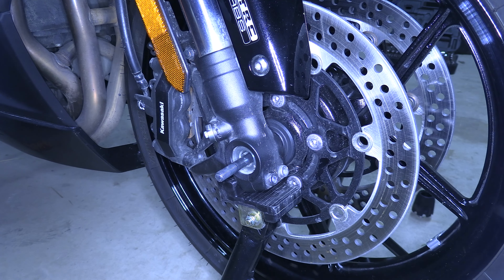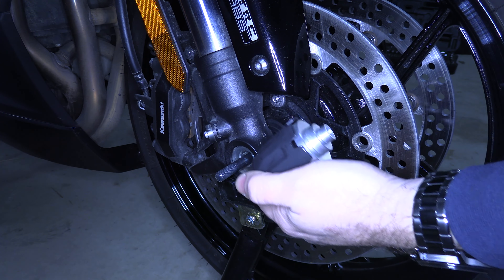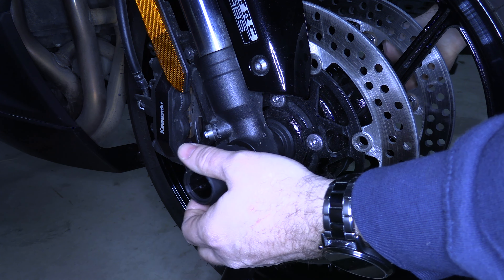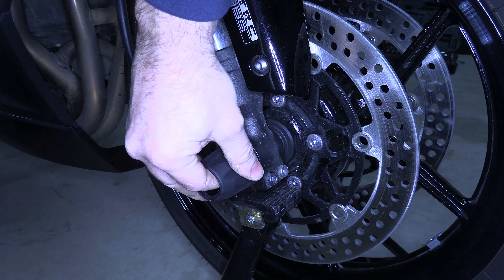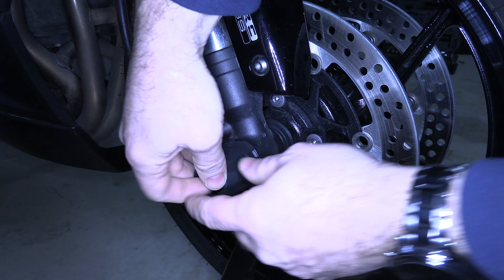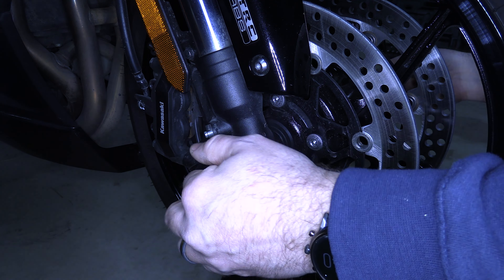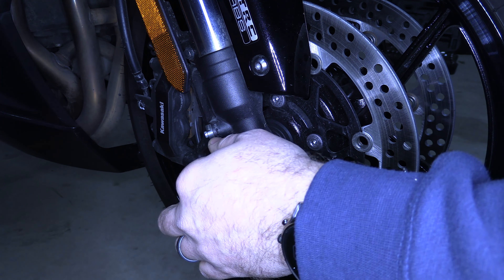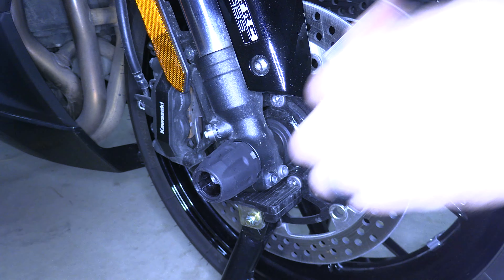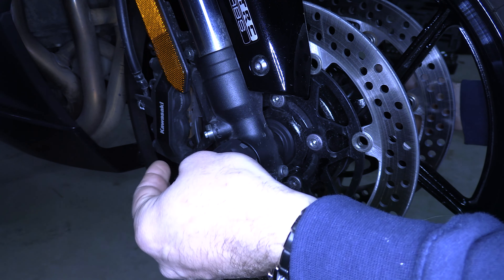So we are on the right-hand side now, and we're going to take our washer and nut, and the longer collar — and you'll see that this is actually inset compared to the other one. You're just going to slide and hold it — hold the left-hand side and slide this one on. You're going to take the washer and get it over the bolt, and then get the nut on there. Tight quarters. I'm spinning it with my finger and holding the other side with my other finger, trying to get this tight. I'm going to go ahead and take a deep well 14 millimeter socket, stick it on the nut, and try and get this thing threaded on. There we go.